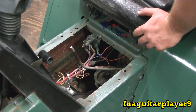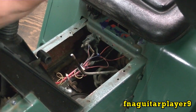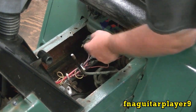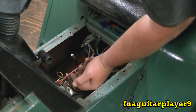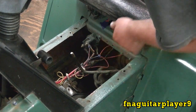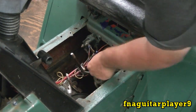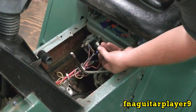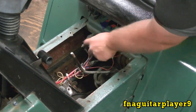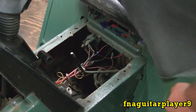The wiring is pretty simple on the mower. You got your hot wire coming in from the battery - like I said you just follow your hot wire. This is your hot wire coming in on this side. This wire here is what goes to your safety switches and your ignition switch. And this is for the lights - it's got lights in the back. This wire right here is your trigger wire for the solenoid. When you turn the key to start, the power comes in here and turns the coil on. This either has a connector that slides on, or a connector that slides over the bolt, or a ring terminal on it. So just pay attention to how your wires are. Take these two nuts loose here and we'll take the wires loose.